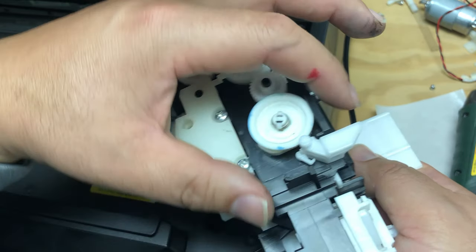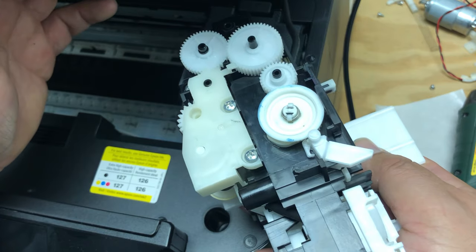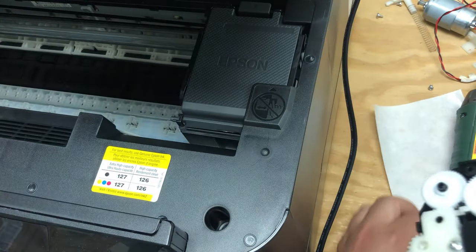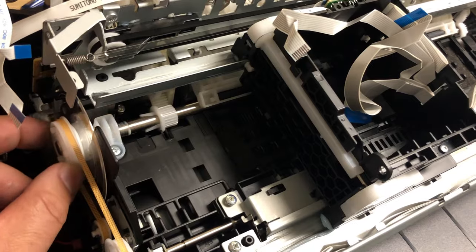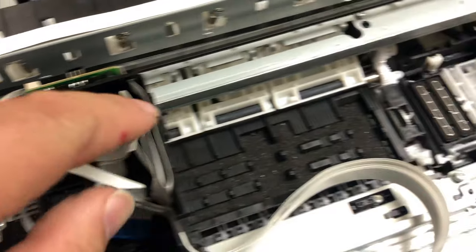When the big wheel turns on the big bulge, that will push the lever and lock the printer. Anytime that bulge is not engaged, the spring will pull the lever back, so most of the time it's unlocked. The power to turn those gears comes from the left side of the printer, and it turns this rod that connects to this small wheel.